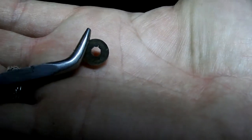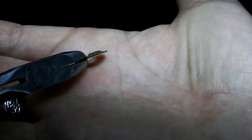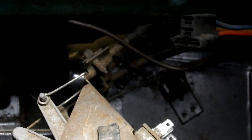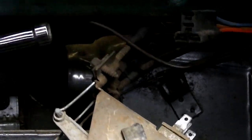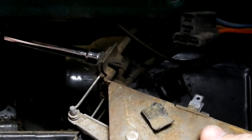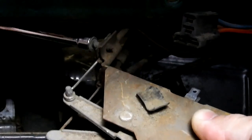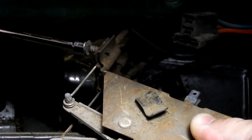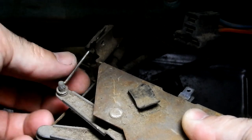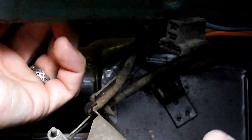This is like a washer, but it's got a little bit of a lip - you can see that. If it doesn't go back on and stay on, you can try to flatten this out and crimp it with pliers. We need this top one, so we're just going to take this screw off - it's a quarter inch, using a nut driver. Be careful when you disconnect this; it may fling around on you if it's got tension on it, depending on which direction it's going. Once you get that off, you just lift this off and that's released.